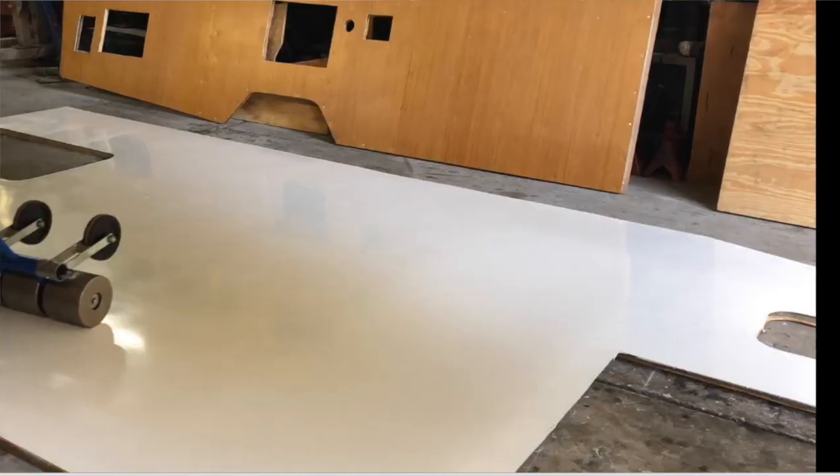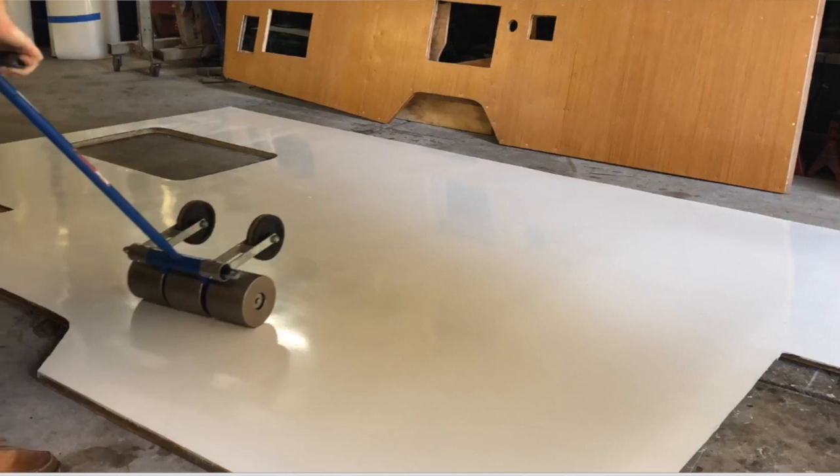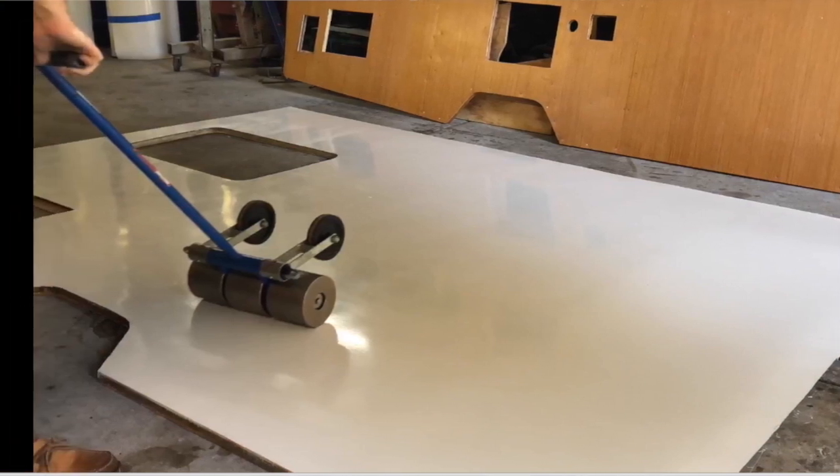And perhaps while we were doing that, we had uneven compression of the adhesive underneath the Filon, and some got pressed down more than others or whatever. The funny part is, at the end of the rolling, if you pause the video, or I'll attach a photo right here, you can see that the Filon looks great. There's no visible turbulence or waves in it whatsoever. But it wasn't until like 2 days later that you could see all of the turbulence and whatnot, which would obviously imply that this occurred during the curing of the mastic.